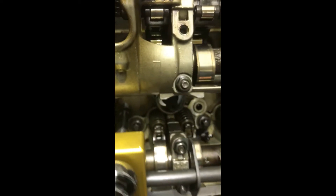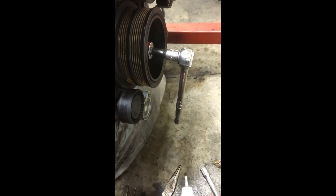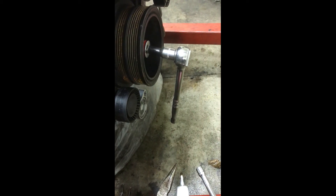You can actually do this little sanity check - it's slow and methodical, make sure you don't drop anything. I'm sure my valve is in place, my piston is in place, but I have my rocker arm there and I have to get that out. So I'm going to turn my ratchet counter-clockwise, it's going to drop the piston. When I drop the piston, I can come in and push down on that rocker arm tip - it'll go down. Those keepers are still in place, so no need to panic. When it goes down, I'm going to lift that rocker arm out of the way, then use my ratchet to bring the piston back up clockwise.